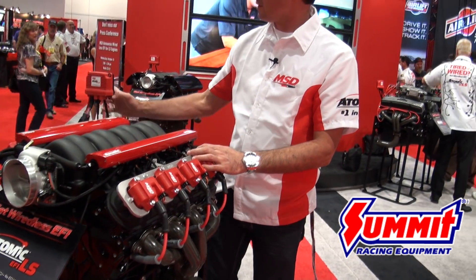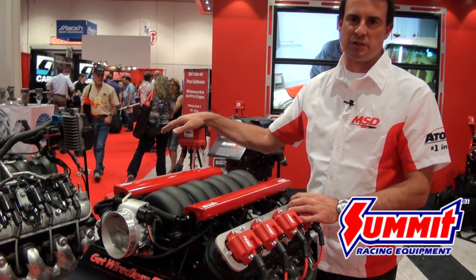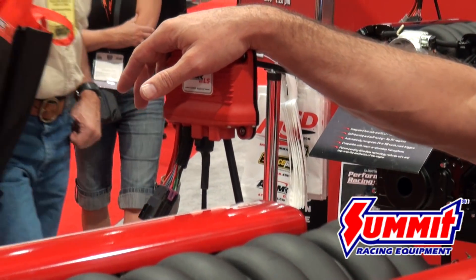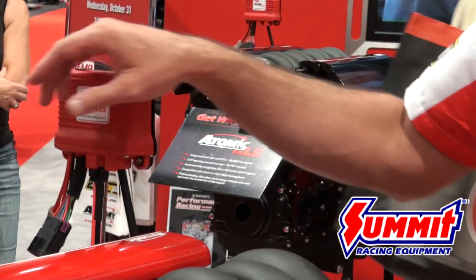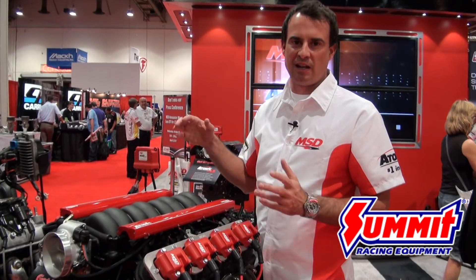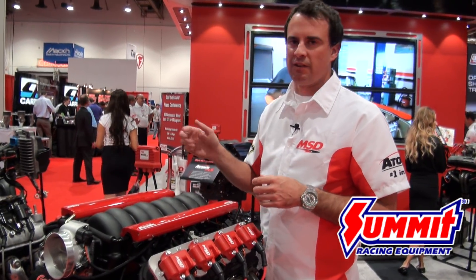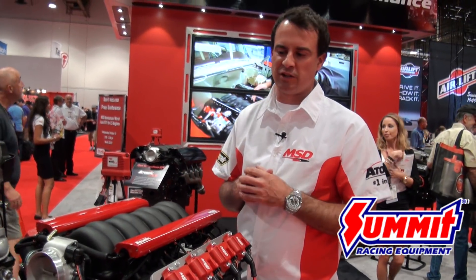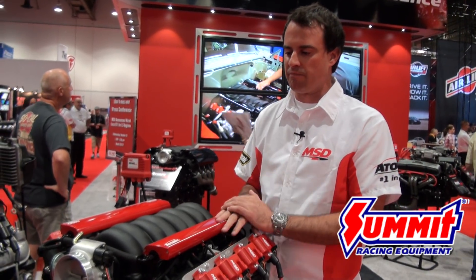It all connects to this fuel controller box that controls the fuel pump. It also contains the O2 sensor, which enables self-tuning. So not only do you not need a wiring harness to make this product work, you also don't need a tuner — it's self-tuning. You dial in one of the 14 different LS engines you might own, along with some basic information that any car guy would know, and the Atomic LS takes care of the rest. It self-tunes as you drive, and it only gets better as you keep going.